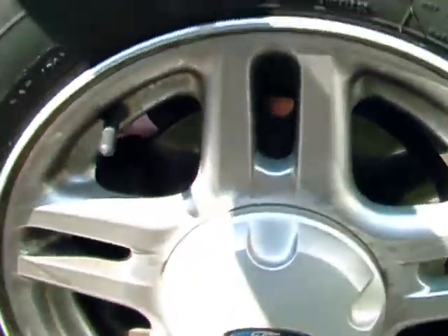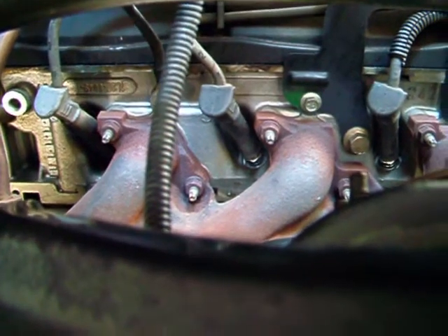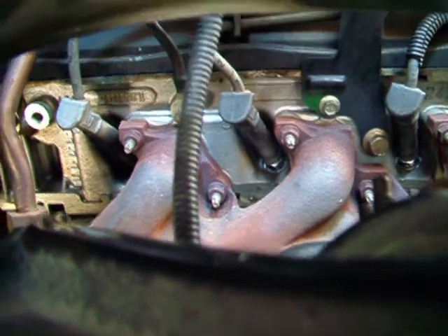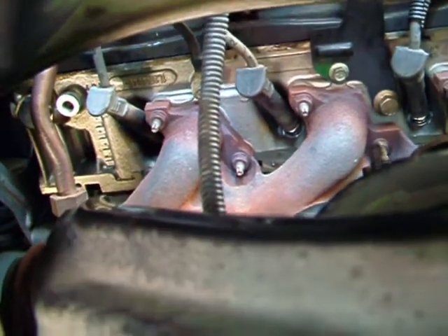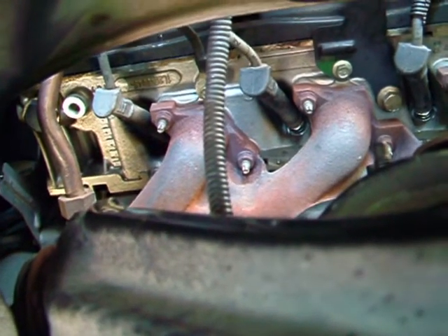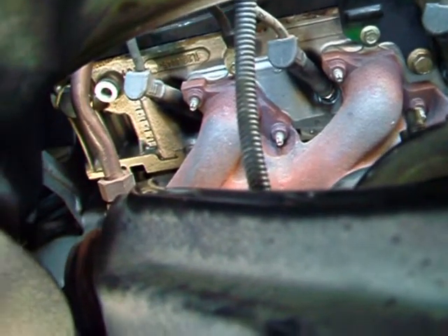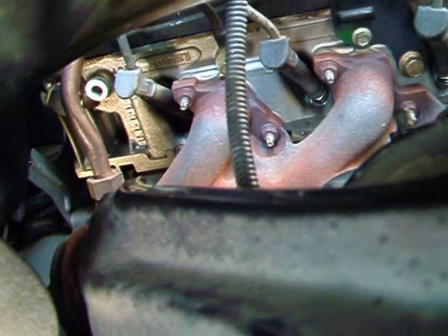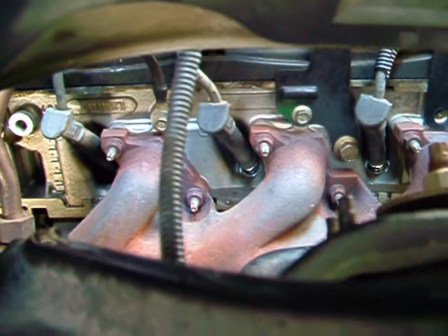The key to this, which saved me a lot of time: come down here, take off your tire, and look underneath — all three spark plugs are readily accessible and your hand can actually easily fit in there. I jacked up the car, put it on a jack stand, and took off my tire. I've read where some people like to take this cover off, but there's no need to do that — there's actually plenty of room in there to replace all those spark plugs.